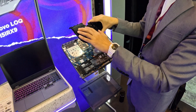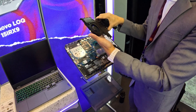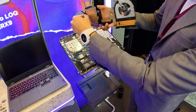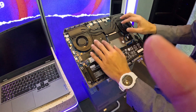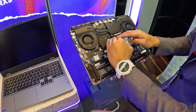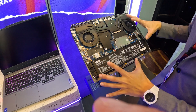So with this new way of integrating it, there are no air gaps. And where the gaps are, it's actually over here right at the side — and that's where the airflow is directed directly out towards the middle. But if we do not create this chamber, this hyper chamber, to prevent the air from flowing downwards, air will just disperse around the system.